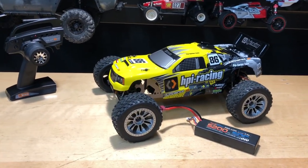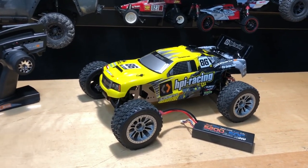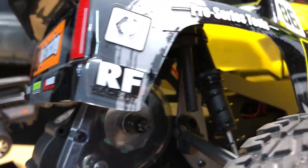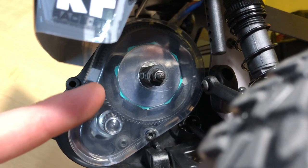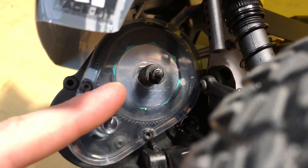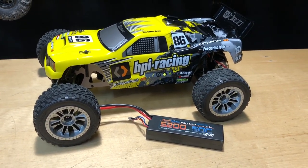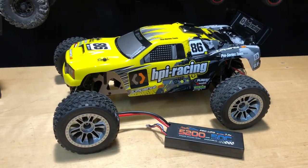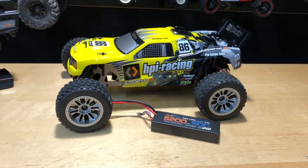You can look at other YouTube videos on that as well. If you guys want me to do a video on breaking in your motor, I can do that. I want to gear this thing up — let's take a look at the gear ratio. I think it's like a 17 tooth pinion, and I'm not sure what the spur gear is. You can tell there's a small little pinion gear and a huge spur gear, so the gear ratio is way off. The reason for that is it's not going to heat the motor up as fast, so you get a little punch with it but not the speed. If you're looking for more speed, you'll have less torque and more top end if you gear up the pinion. If you guys want to see it on a bigger pinion gear, leave a comment down below and let's see how fast it goes.